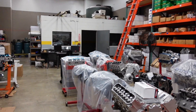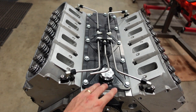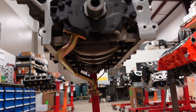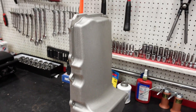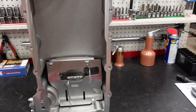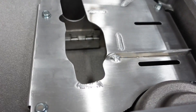It's going to be sick. A few things have changed since last time — we are running our four-corner steam vent kit, and we did put the valley cover on. Right now we are ready to seal up the bottom end, so we're going to install the timing cover, install our stroker oil pan, and then assemble the valve train. This is an LS swap oil pan that's going to work perfect in his BMW chassis. It's very compact, will clear a huge stroke like we're running, and we also added an aluminum trapdoor baffle plate to help keep the oil under control on a road course so we don't have any windage problems.